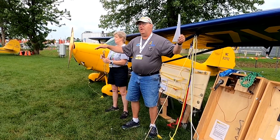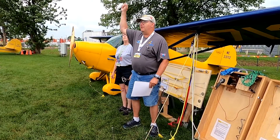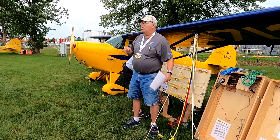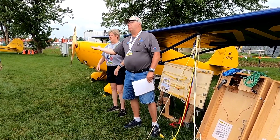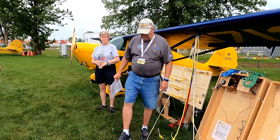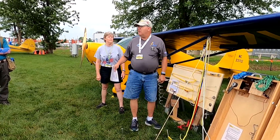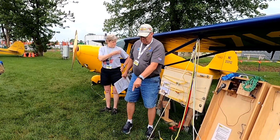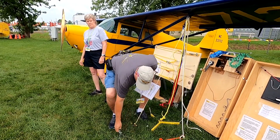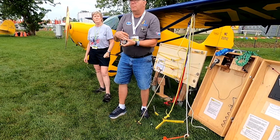We saw the storm coming in. We were getting ready to go to the hotel — only three people there — and we saw the wings wiggling more and more, so we drove right out to it. Just as it pulled the stake out of the ground, we grabbed onto the strut. It pulled one out of the ground and broke one off the tail. That airplane was going to roll right over on top of Brian's airplane, but Brian had forgotten his tie-downs. I had my homemade stakes with me — nothing more than chain link sticking out with a quick link in the middle. It holds really well. It held that airplane all through the storm and didn't wiggle a bit.